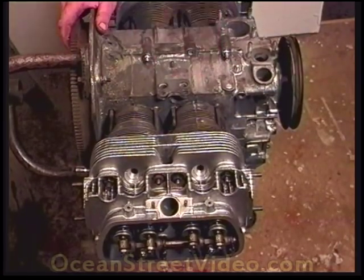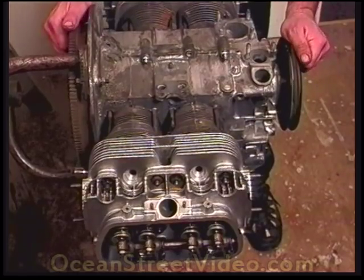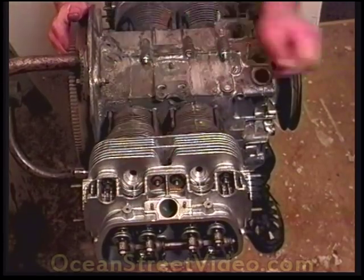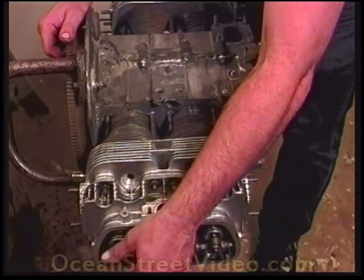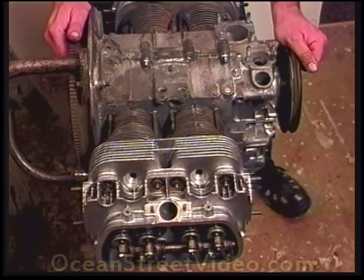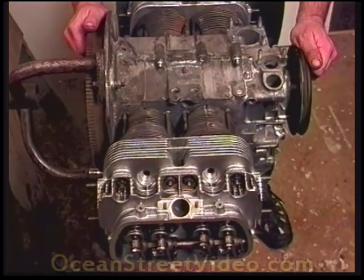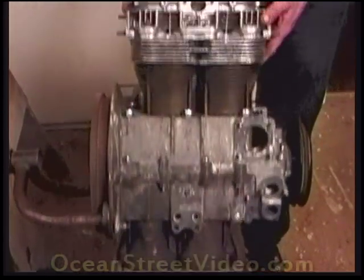The reason I explained this is because you can turn this pulley around and it looks like you might be firing number one, but you're actually firing number three. Number three right here has no movement, but number one will. People sometimes will go ahead and drop the distributor drive gear in wrong, and then will have to set up the spark plugs and the distributor completely backwards. I prefer doing it right the first time. So we'll bring it all the way back around so we're firing number one — now you can see that number three is rocking and number one is not.